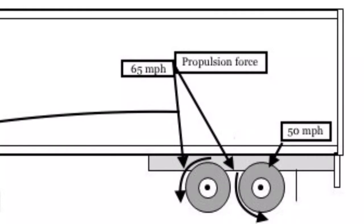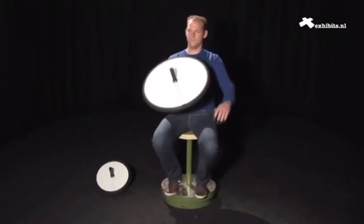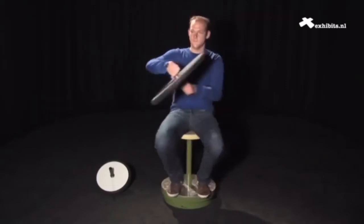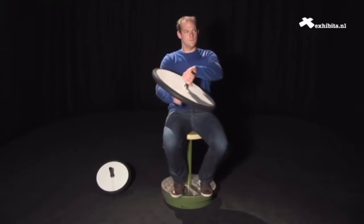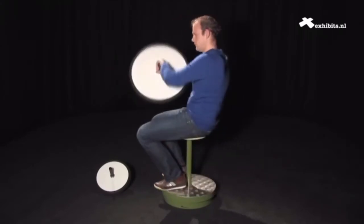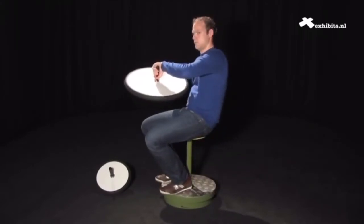The only thing needed to cause a disastrous trailer swing is a gust of wind to knock the trailer off the tractor's path, or the direction that you're going. I don't know if you guys ever took a science class where your teacher would have you hold a bike wheel in a swivel chair — you're spinning the wheel and then you tilt it to the side and you swivel towards the direction that you're tilting your wheels. That's pretty much what causes a trailer swing when using your Jake brakes in the rain.